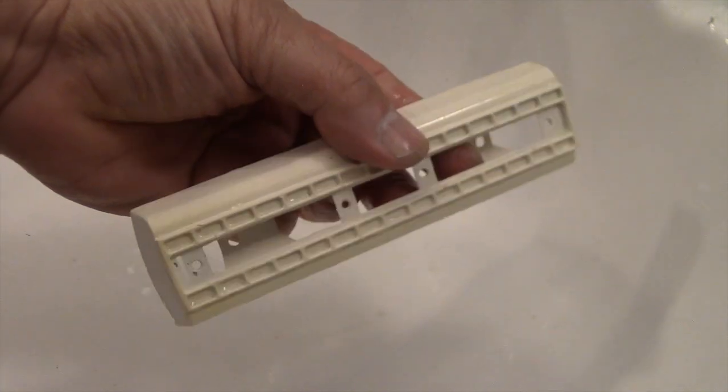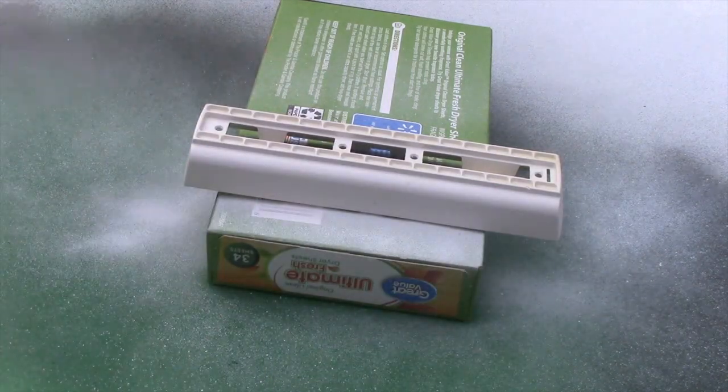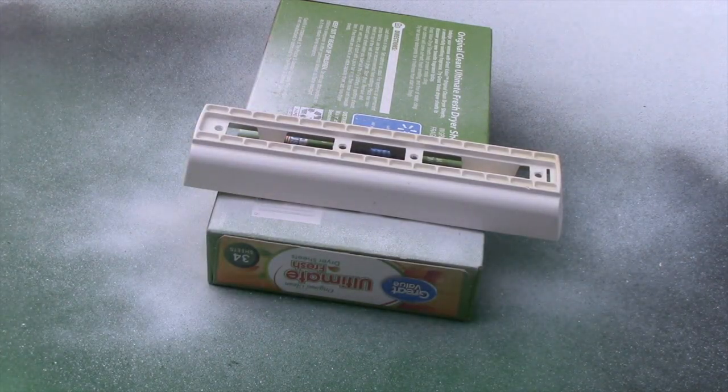Cleaning and wet sanding with 400 grit paper removes any dirt and even some of the yellowed coloring of the plastic. I still want it to be as bright and shiny as possible, so I'll spray it with a few light coats of Rust-Oleum's gloss white.